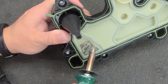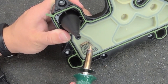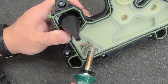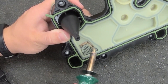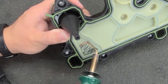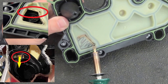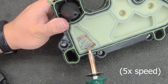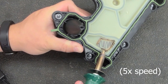The reasoning for having such a large hole on the bottom side is because anytime you want to move air and not oil or liquid, you want to have as small of a pressure drop across the opening as possible — so we want as much surface area as possible. That little 20 millimeter bit we did not cut out is specifically because that is the direct spot where vacuum is pulled, and you probably want it shielded a little bit from cam spray. Go slow, because you can always cut more — we'll speed up the video so we can get to actually opening it up.